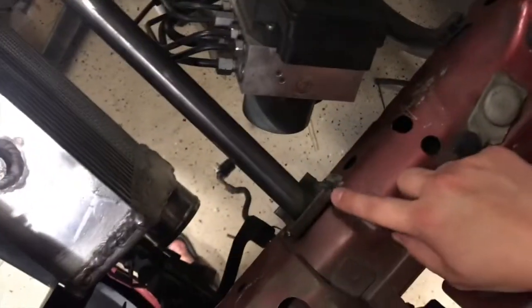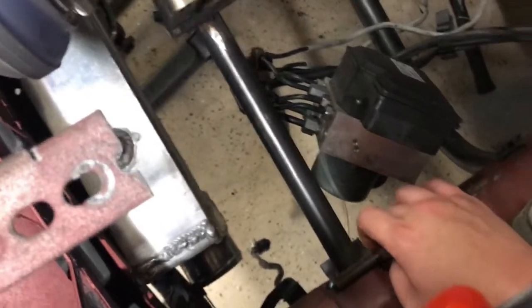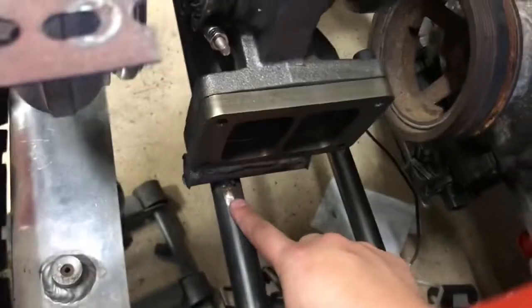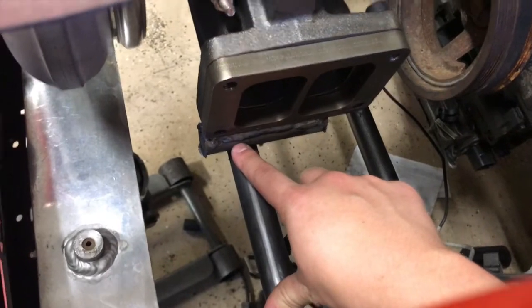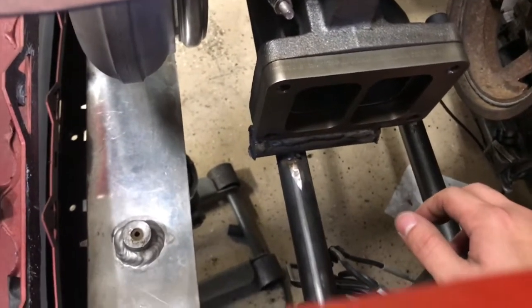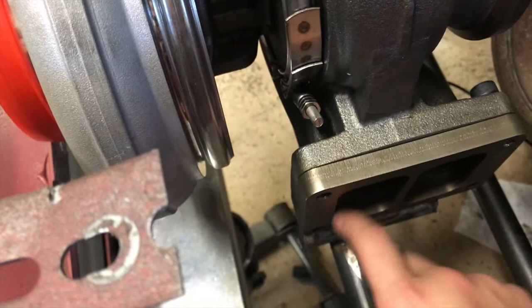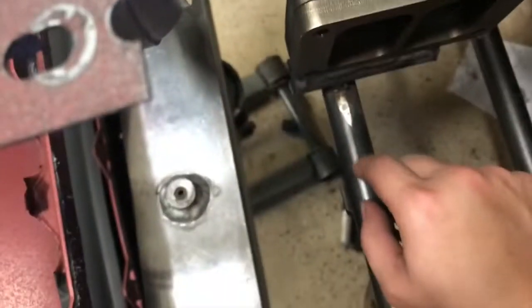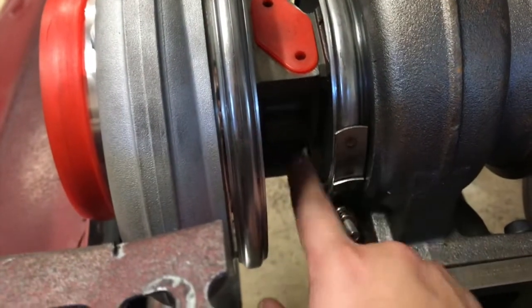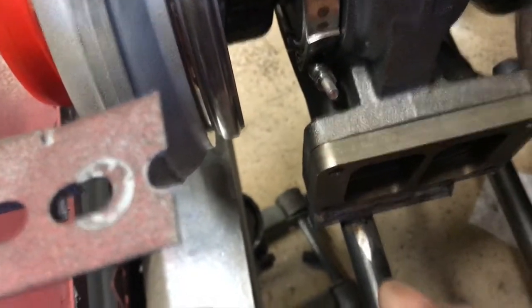This is actually how I have it mounted: I made this little crossbar with little steel squares, and this is welded to the frame because I didn't want to weld just one little thing — I wanted that stress to be distributed, since this is thinner gauge metal. I just welded the T6 flange to this. I could have clocked it downwards, but that would have set the turbo back because it would interfere with this bar right in the way of the oil drain, and I don't think there's really any benefit to doing it that way.